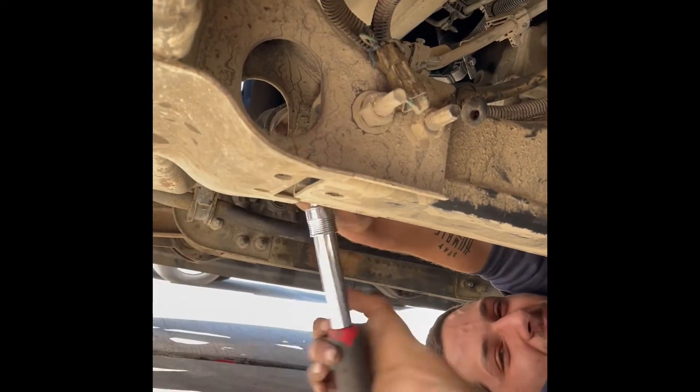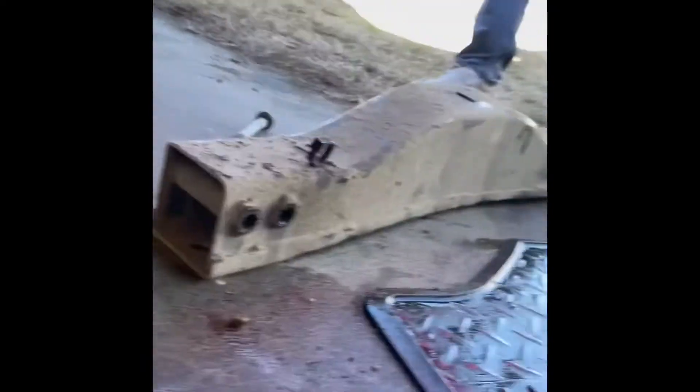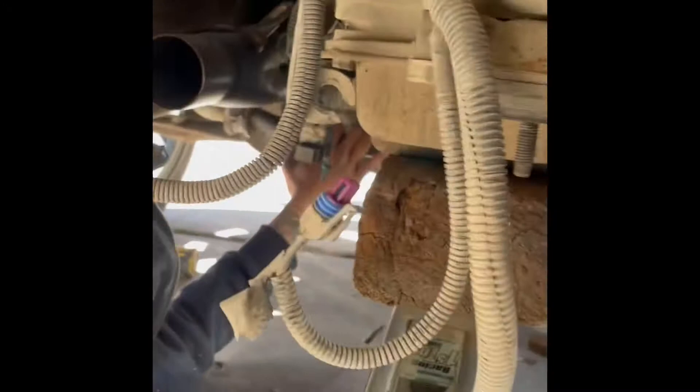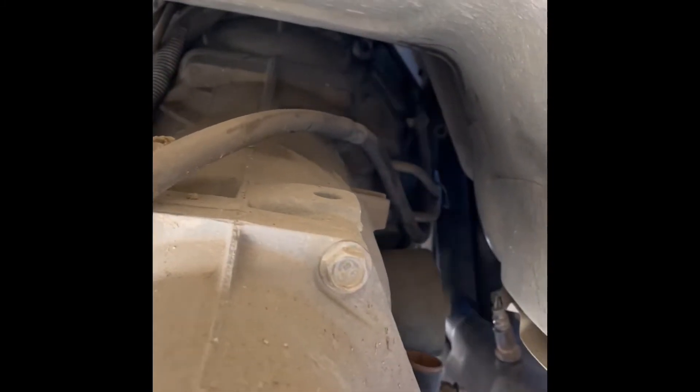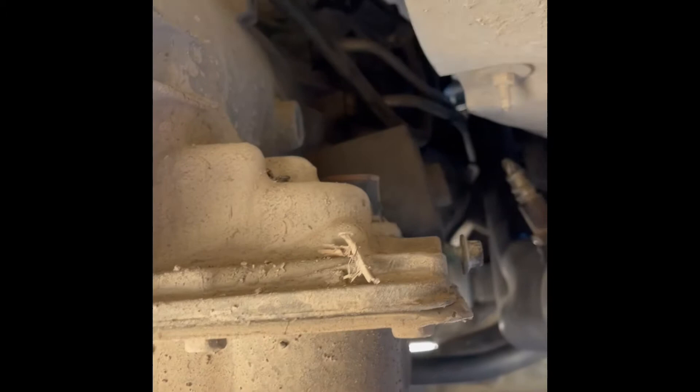Is the nut spinning on that side? No. Yeah it is — alright, I'll loosen it. So we've got the cross member out for the transmission. It's all unhooked, got the shifter cable done, got pretty much everything unplugged as far as electrical. We've got our transmission lines up there, we still gotta unhook — about to unhook this. I think it's an evap line or overflow for the transmission. We've already got that unhooked. We just gotta go around and finish up getting all these bell housing bolts out and we can pull this transmission.